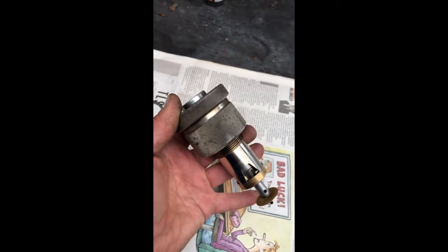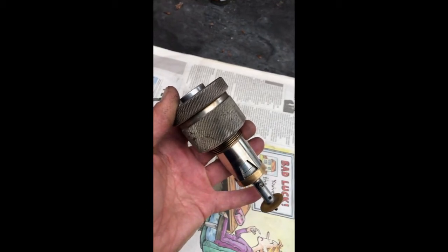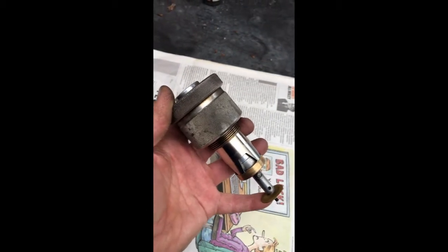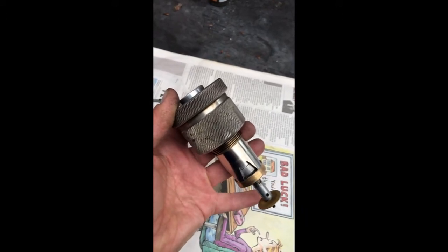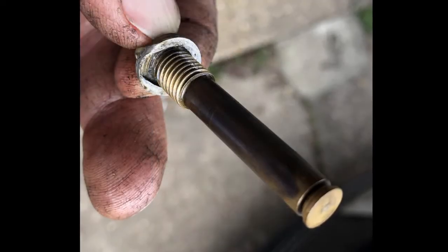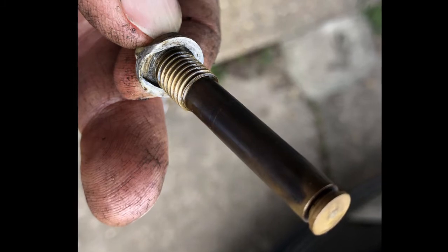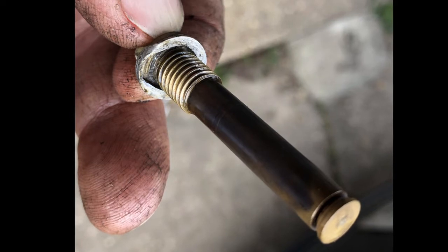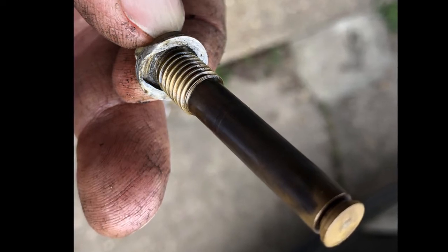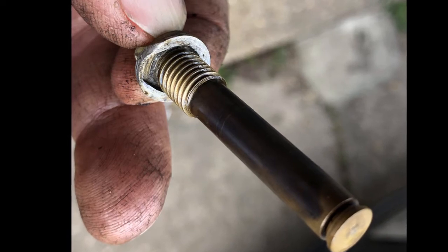This is the air valve from the carburettor that blends the high and low-speed jets together, and the movement of that is maybe a little bit faster than it should be. This is the high-speed fuel jet from the carburettor, and you can see a distorted aluminium washer. This must have been leaking fuel past the jet and was causing the engine to run far too rich — a previous owner was complaining of high fuel consumption.